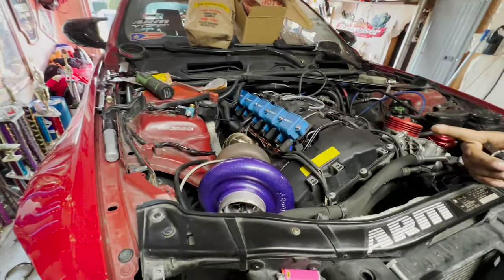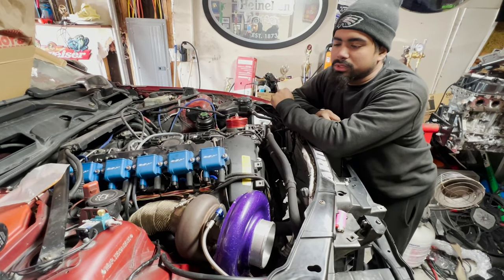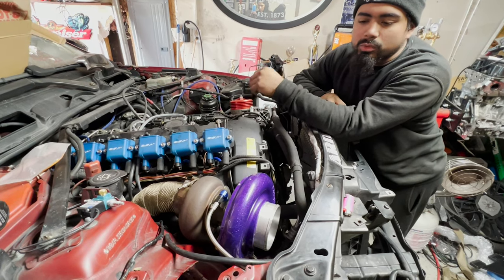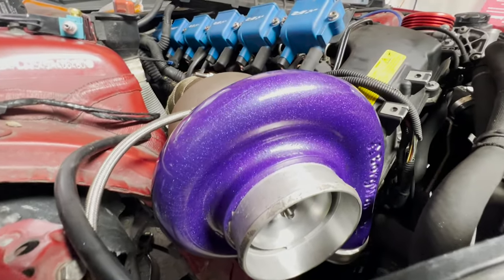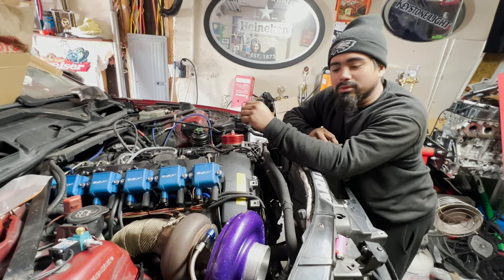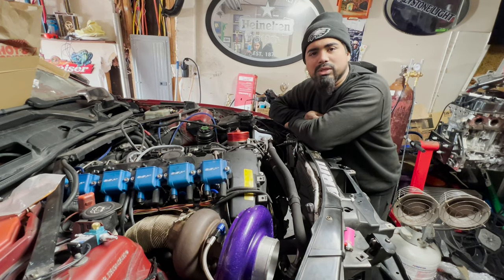We can do bottom mounts and all that. I was a fan of the top mount because it's a big turbo and an M54, so that's something you wanna see when you open up the hood. So I built my own manifold, the downpipe, the wastegate dump tube and all that. We went with a Borg Warner S362 turbo. A lot of people use these turbos on trucks and all that. Here, we're putting it on a BMW M54. We used a Turbosmart 44mm hypergate wastegate.